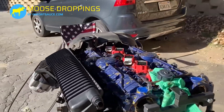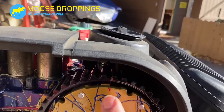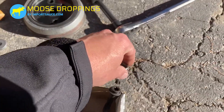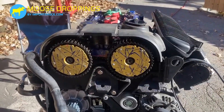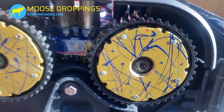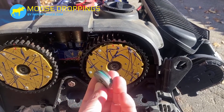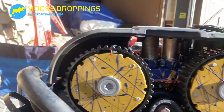Now we know these are locked into position. We can go ahead and put our bolts back in and make sure these are lined up to the timing marks where they need to be. The bolt is a T55. We're going to torque those down — they will not move because our cam locking tool is on. Torque is 120 newton meters, which is 88 to 89 foot pounds. We can see our marks line up. Now we're putting our brand new caps on with brand new O-rings at 35 newton meters or 26 foot pounds. Timing marks are still lining up.